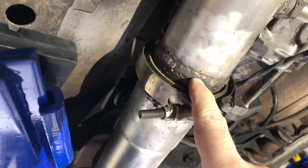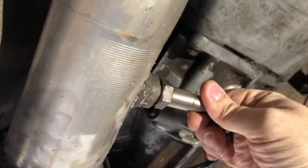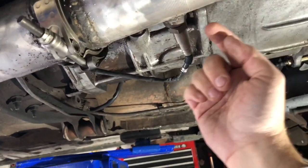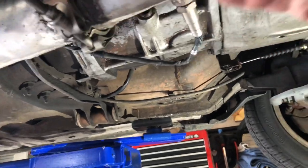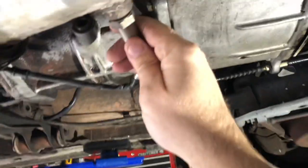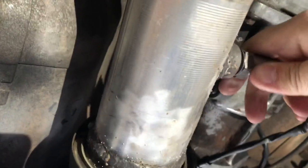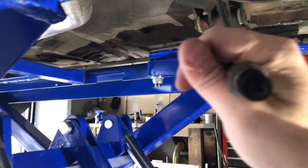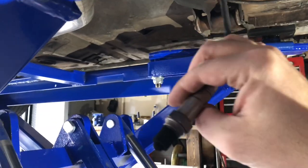I think one of my problems here is the O2 sensor is coming in horizontally, parallel to the pipe. These things are supposed to be tipped up in the air coming down into the pipe, but I've got mine mounted 90 degrees when it should be more like 120 or so. You also see the carbon — I just cleaned this thing the other day. I'm running really rich.